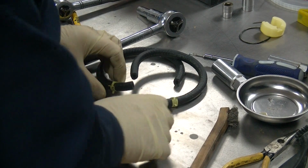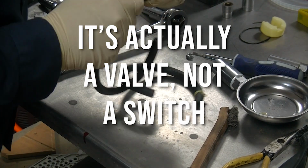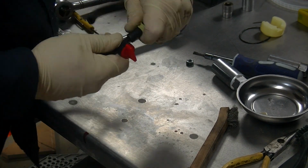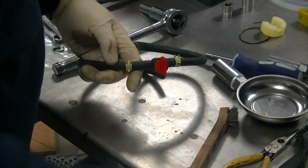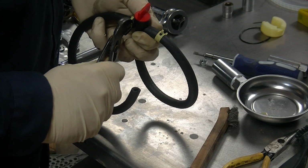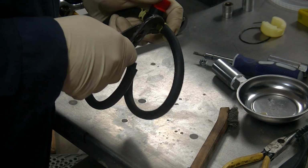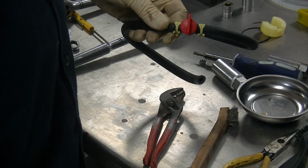I took this opportunity to put on a fuel cutoff switch. If I have a long period of time in between snow events, I can turn this in the off position and then I can drain the fuel out of that cup. Then when it snows again, I can open that valve again and get a nice fresh shot of gasoline to come in there. Anything I can do to keep gas from sitting in that cup for an extended period of time. Gas stabilizer treatments, winterizing treatments, those will help. Fuel's off, fuel's on.